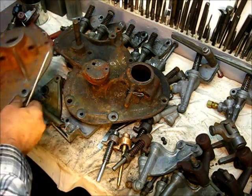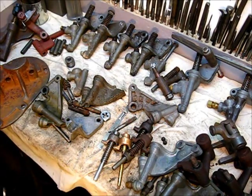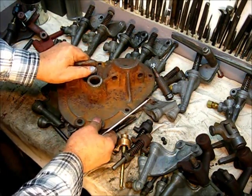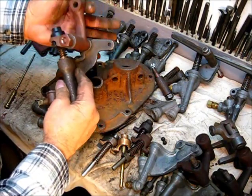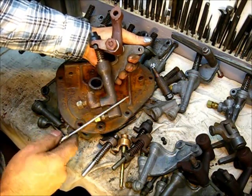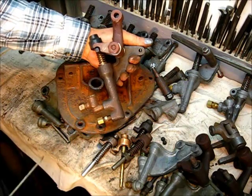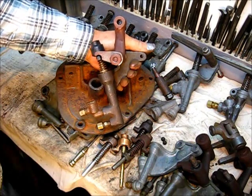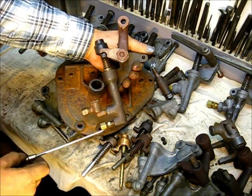Let's set this aside and work up. Let's start with the early one. This very early one right here used this type of fuel pump. This is the very early fuel pump — cast iron, external check valve. It has two balls in it, and that's all a fuel pump is. It's got two balls in there; it's a check valve.